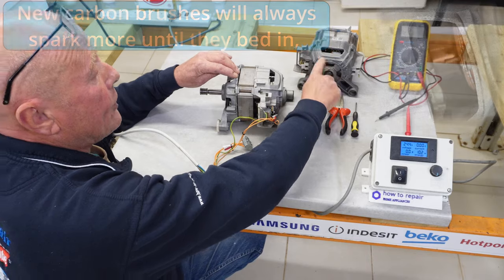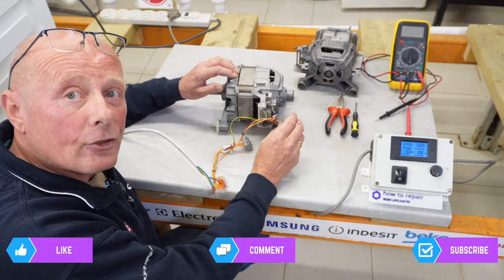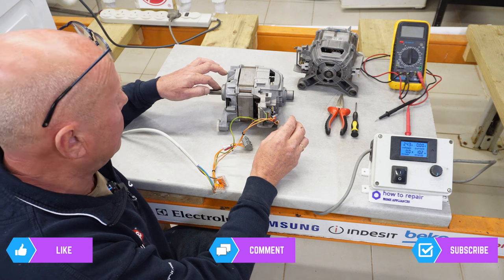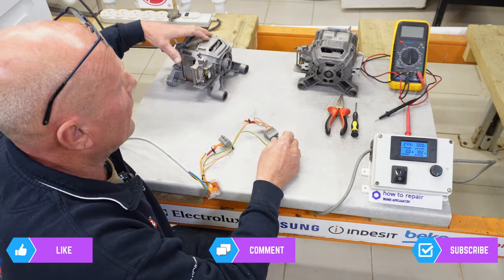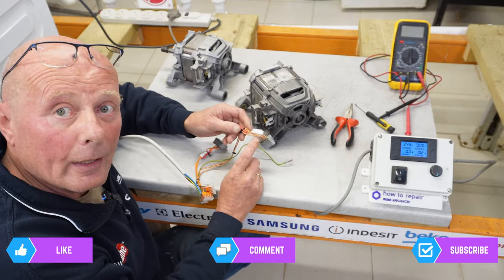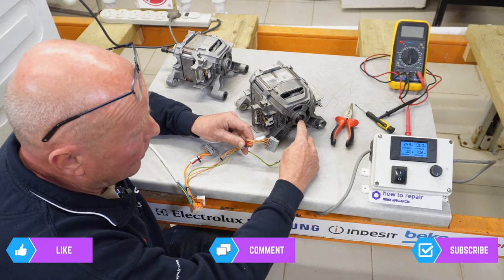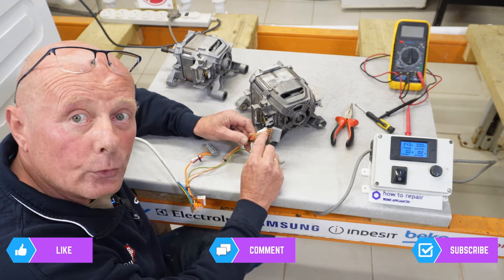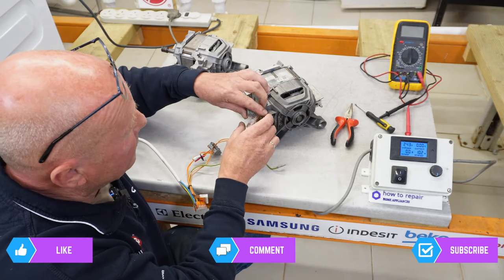This other motor is off a different model of machine and it is a seven-pin motor, but the six-pin harness will actually do the same, testing the lower fields, not the higher field. I have a separate lead for testing both sides. Let me disconnect this and bring this motor across. I've done a detailed video on Bosch machines showing you the wiring configuration — that's at the website. Basically, the two wires go to the tachometer which sends information to the circuit board, the other two wires go to the carbon brushes, and the other two wires go to the fields on the motor. The seven-pin testing system goes to both fields.